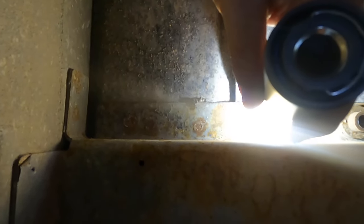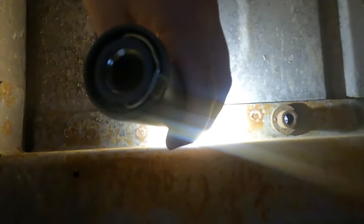So you can see here, I marked out the ideal spot on our rail. And it's just really tight to this. I don't think I can fit a half inch bolt in between that hole in the frame. So I'll have to seal that with silicone while I come up with a new plan. I'm trying to do something similar back here. I think what I'm gonna have to do is just drill a hole and come backward with it a little bit. There's just not really a choice but to come back here and try and get as even with this one as I can and see if that'll fit the rails.